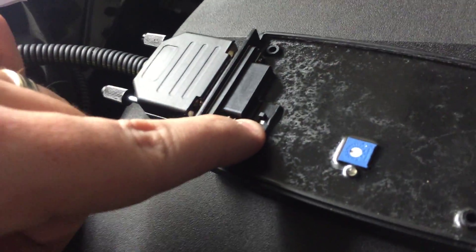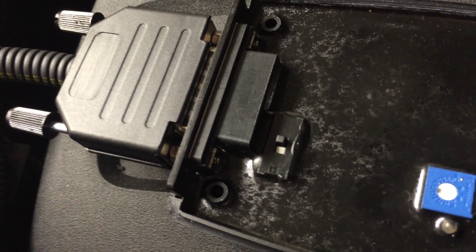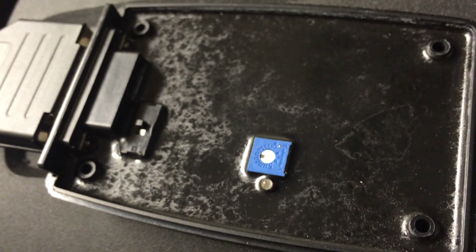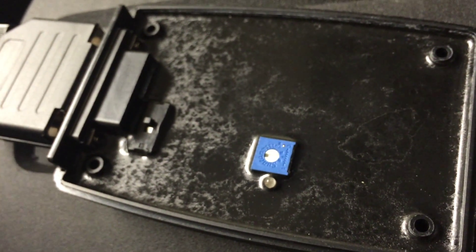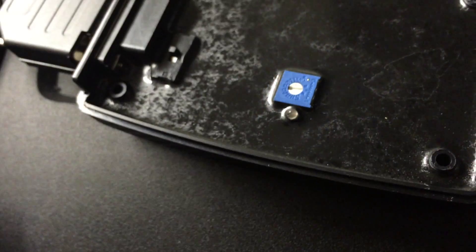So they've told me in the instructions to leave this switch alone — it needs to be left on A. You can see there's a little B logo. So I've left it switched on A, and they default set it to 5. The instructions say just leave it at 5 for now, but depending on what vehicle it is — Toyota tends to like switches maybe 1 through 3, Audi and Volkswagen tend to like switches 7 to 10. So it says to just put it in there, leave it at 5, flick the ignition on, wait for that LED to turn on — that means everything's connected okay and it's getting the signal. So I'm going to go ahead and do that.